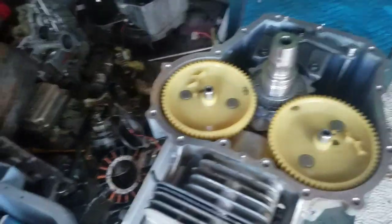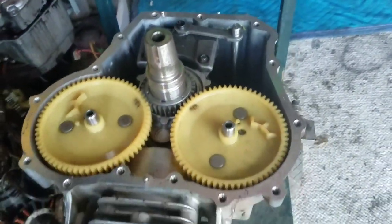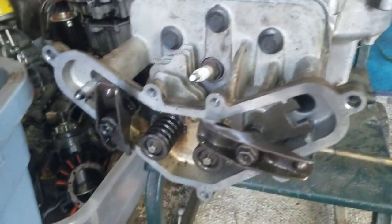Where is it? There it is. That's a good sump cover with the plate and the governor reattached onto there. The gasket actually is good on here, sort of. But as you guys know, Kohler actually recommends you use RTV. I cleaned the surfaces there. I'm going to put a layer of RTV, as well as over here as well.